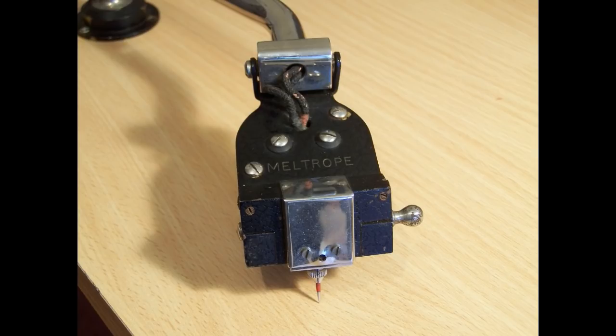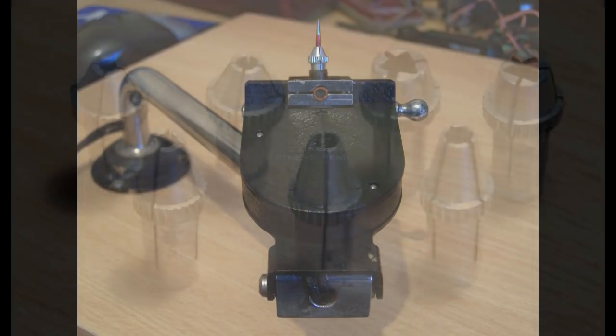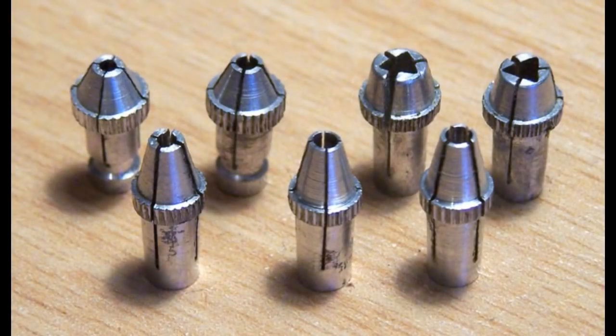Here's the business end of the pickup. It's got a coil in it, which is in good shape — 1500 ohms DC resistance, which is the spec. The first thing you'll notice: it doesn't have a needle screw. This is absolutely typical of Wilson; he's designed it from the ground floor up with lots of clever things. The main one is not a needle screw but an aluminium collet. This is because fibre needles, synthetic needles, and thorn needles were quite popular at the time, and if you screw a screw into one it disrupts the internal structure. So he chose lightweight collets — and not just one, but the arm came with a set of seven collets: several different sized round ones and also triangular ones for bamboo needles, which are triangular of course. An appropriate collet was supplied to cover every eventuality.